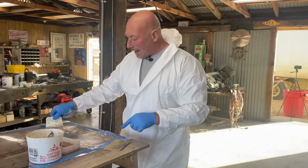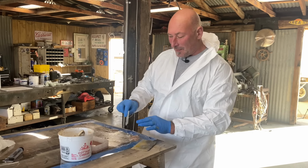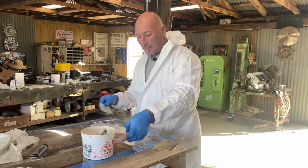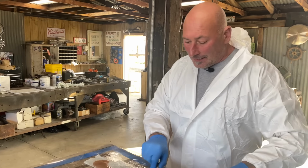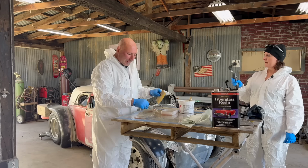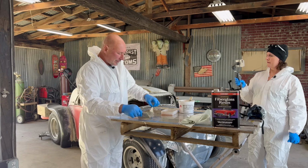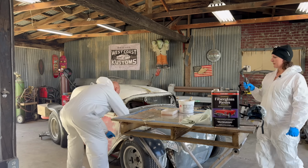And you see all these little fibers that are starting to gather. Each time I spread it, there will be a perfect little drop of material at the end of it, if there's any hollows I want to fill up. Because the perfect laminated thing would have zero gaps between the material, zero air bubbles. They have these vacuum bags they put over things that compress it. But again, this quick hand-laid procedure will work for our fenders.